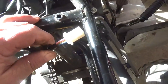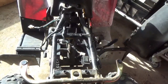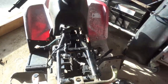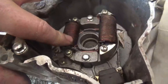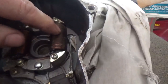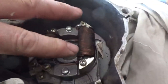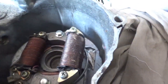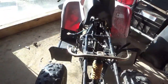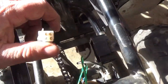You don't see a black wire with a red stripe, which tells me this engine wants a DC-powered CDI. There is no separate coil to power the CDI, so you've got to go with the DC CDI. You probably only have coils in there to charge a battery, and once you have a charged battery you hook your CDI to that, and that's where you get your spark from. So we know we want to hook this up to this somehow.